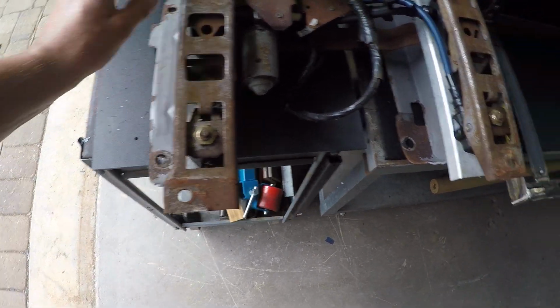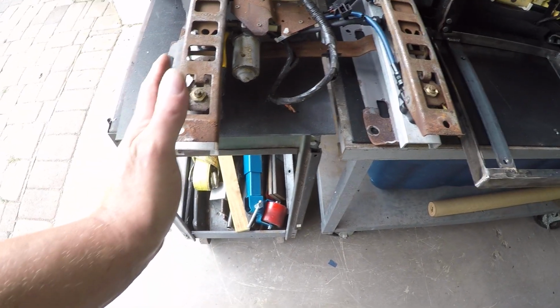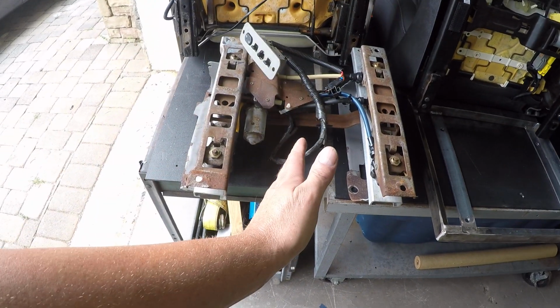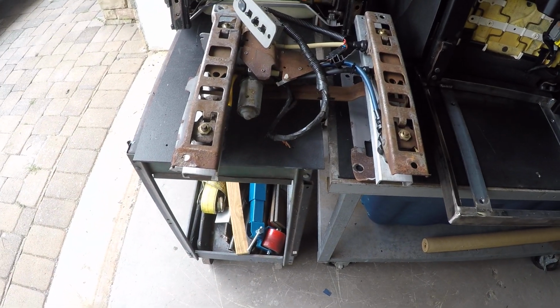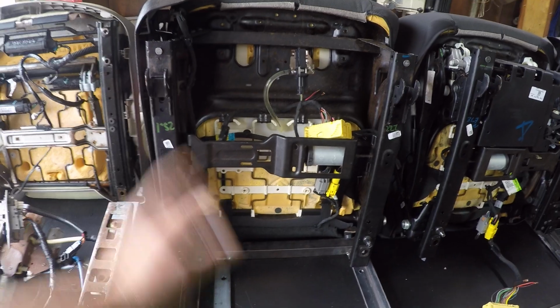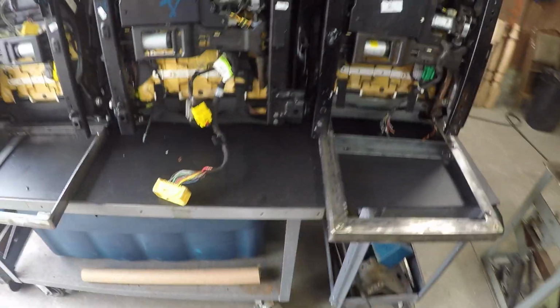These are your 4 mounting points on your floorboards. You can see that this seat is shifted over. This is the driver's side. You can see how far it's shifted over. That's so that the seat can be centered with the steering wheel. So these are obviously a lot of the challenges we have when taking this newer style seat, which is pretty much symmetrical. These rails run even left and right. So we have to be able to adapt this to this, and that's what my seat brackets basically do.